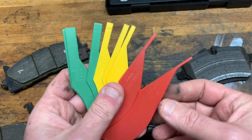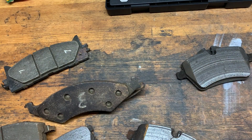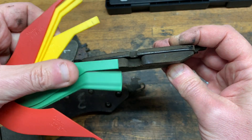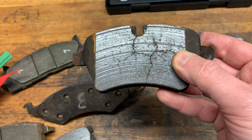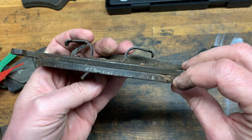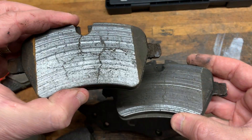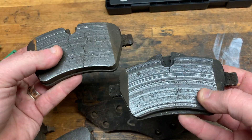You can slip this in through the brake pad inspection window in the caliper to get your measurement. But here's the problem — we're actually supposed to remove the pads to inspect them. Why? Because you can't see that this pad is cracked when you just use your little slip tool and say, 'Oh, your brakes are in the green, you're fine.' With old school riveted pads, you can't really see damage very well. They want us to take the pads out of the caliper and visually inspect them for any types of damage. Those cracked pads are no good — even if there's plenty of friction material left, that could be the cause of noise.